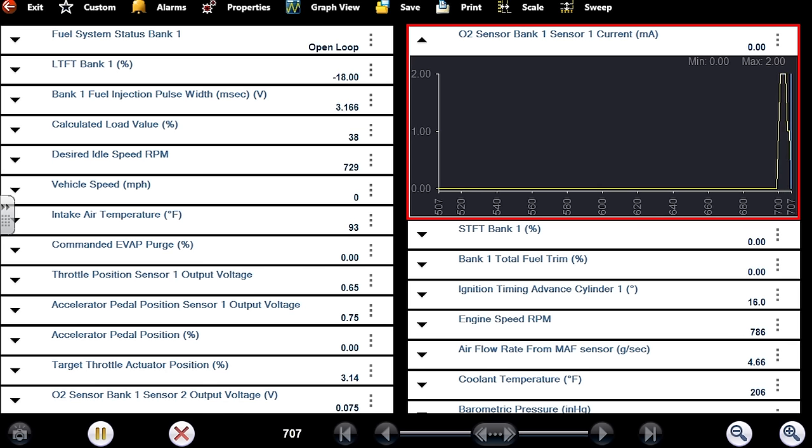Last piece is to look at the lab scope of the mass airflow sensor. We're at about 2.8 grams per second. Calculated load is right about where our unplug-it test was — hovering around 26% versus the 40% we saw before. That default strategy was accurate on this car and the unplug-it test was the key in identifying an over-reporting mass airflow sensor. It was also worse at idle.